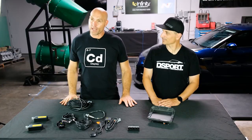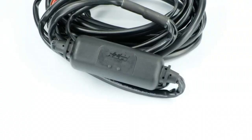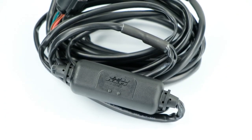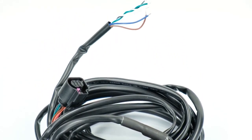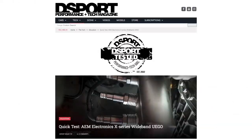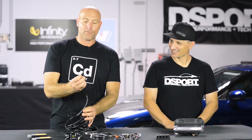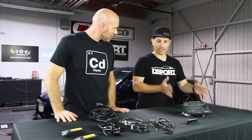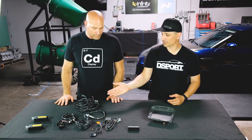You can put a DTM connector on this and actually send that data to your dash. But for people saying they want lambda, they want AFR, and definitely want to get a dash — but what do they need a gauge for? We've got a solution for that too. This is our inline X-series wideband controller. It has all the same features, fastest response time in the industry, all of that stuff. And it also has the twisted wires for CAN output. So getting that AFR into the CAN bus is very simple — you may already have it there, or if you need to add it, very simple solution.